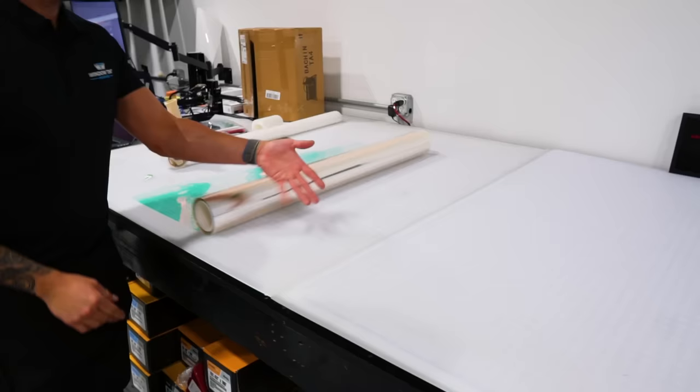There we go. I'm gonna use a Teflon card because there's a lot of dirt on the window and I don't wanna rip the film. This card is soft, it's not a hard plastic one, so any debris it runs over that's between the film and the glass, it'll just glide over it, it won't drag it. Which if you use a hard card, it would rip the film.